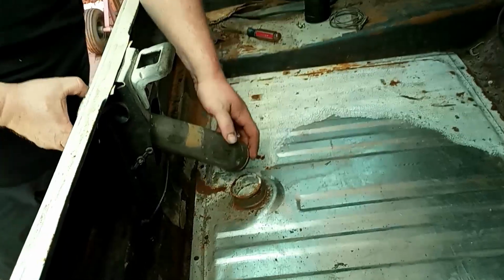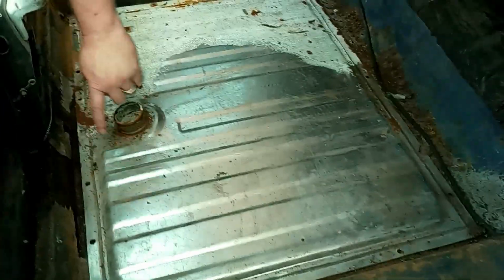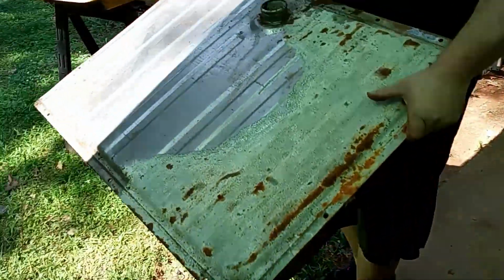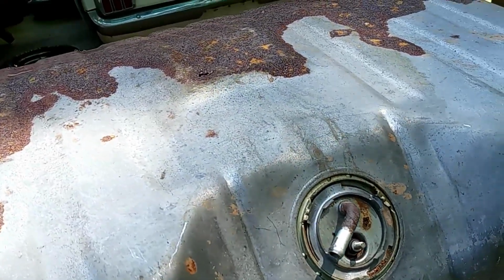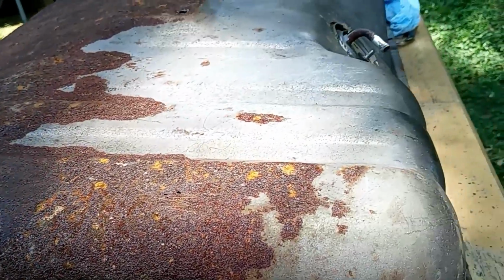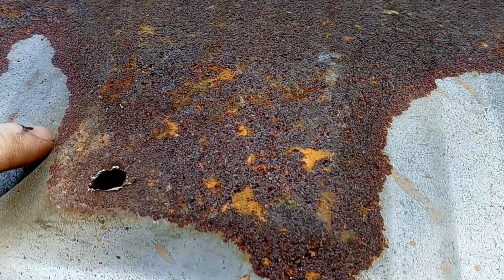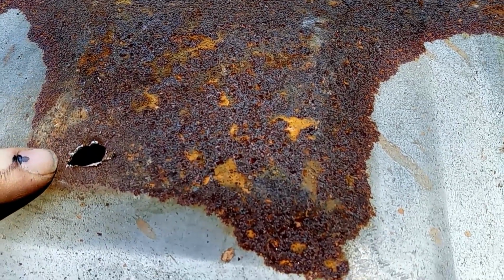Now we'll pull our fuel filler tube out of the way. And I've already removed the perimeter bolts along here to speed up the process. Now it's pretty simple. We're just going to lift the fuel tank up and out. Alright, here is our old fuel tank out of the car. As you can see, it was a little worse for wear, and here is our puncture, which I took a screwdriver and kind of gouged it out a little bit.